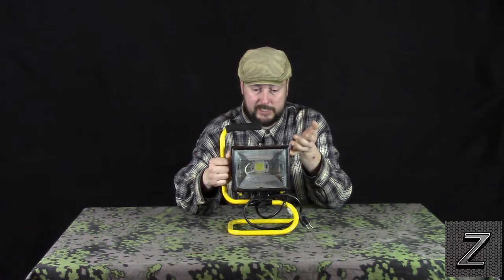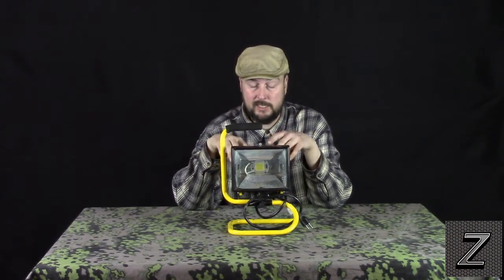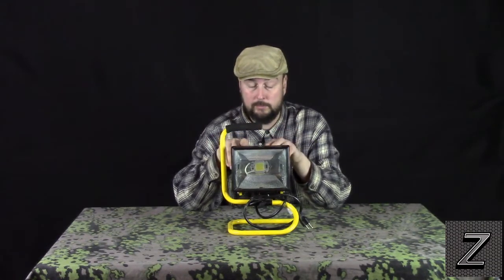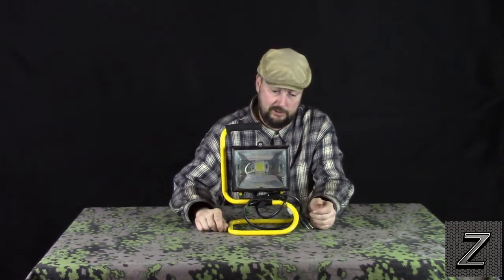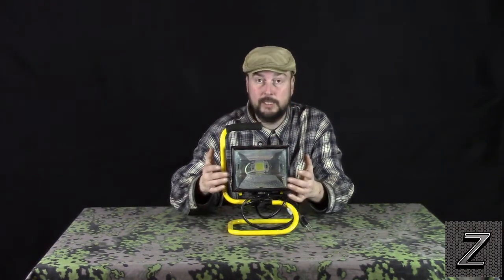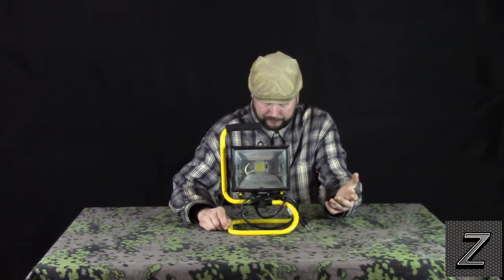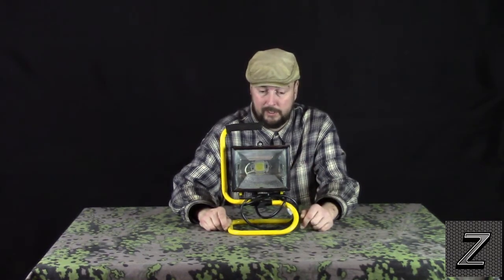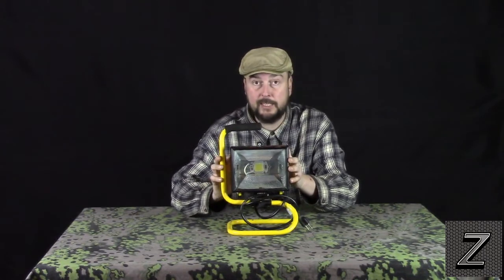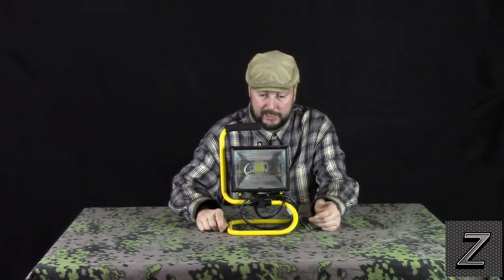It's easy to do and it doesn't get as hot. We are using the casing of the light as a heat sink for the LED. The LED does get warm, a little hot, but nowhere near as hot as the halogen bulbs did. With the halogen bulb in here, you literally could cook an egg on the glass screen. With the LED, no, it's not going to happen. If you put your hands on the back of it, you'll feel it's nice and warm — that's it. You're not going to burn yourself.